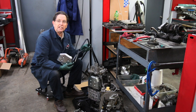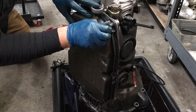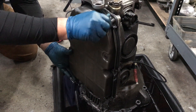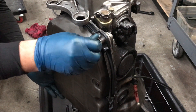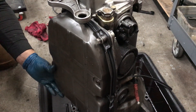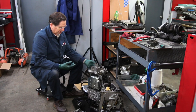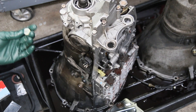We're currently cleaning the pan and straightening out the stops on the pan. A lot of these old pans have been over-torqued, so when you're replacing the gasket you may have to straighten out the bolt holes in some of these pans. Then we're going to put this on the back of Digby's engine. Looking at this, the shift bushing is gone.